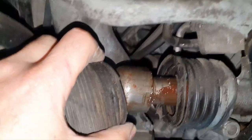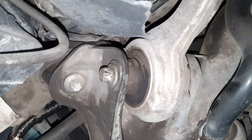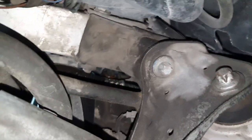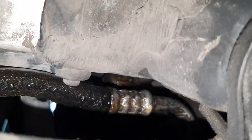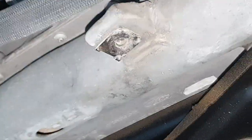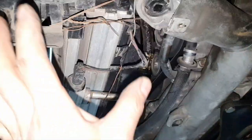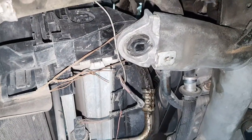Come to see the steering rack. What's the steering rack? Yeah, I have to fill two job cards, not one. It's leaking also from the power steering pump here. Where's the washer? To fix all this mess, you know what you have to do? You have to strip off the front end, take everything out and fix properly all this front piece, with all this shit that they have done.